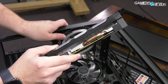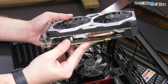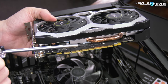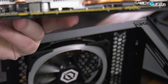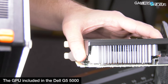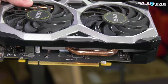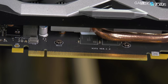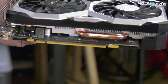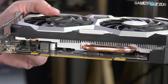MSI — it's unbelievable how completely incompetent MSI is sometimes. They've made some good products, but when they make bad ones, they make the same mistakes over and over. This isn't CyberPower's fault — they did source the card — but there are the memory modules right there. I was just about to comment on how great it is that MSI has put a thermal pad contacting the memory, because Dell didn't do that with its card. However, this thermal pad has about one and a half to maybe two millimeters of contact on the memory module, and the rest of it is just sitting out there — it's not even really under the fan. It's probably quote-unquote within spec, but if you can make a better product with really not that much change in the bill of materials, why wouldn't you do it?